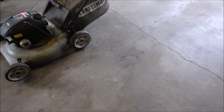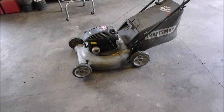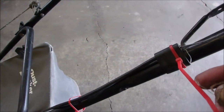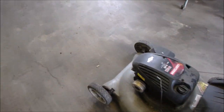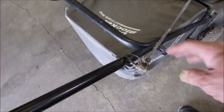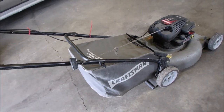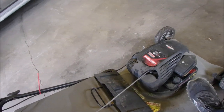It is ugly. And I've always said there will be three things wrong with every mower. Well, this thing's got three things wrong with it right out of the gate. This cable — the stop and start cable — that's where it quit right there. Somebody got clever. There's nothing wrong with this when you don't know anything about lawn mowers, but they didn't even do a left over right and a right over left reef knot. Air filter's loose and backwards.